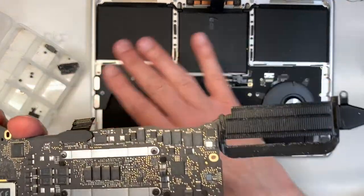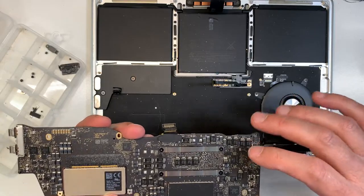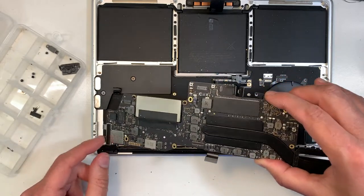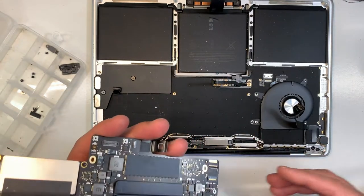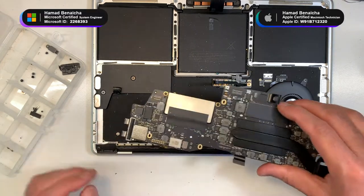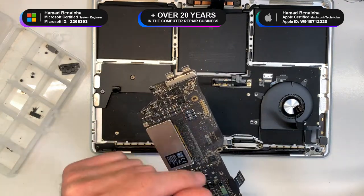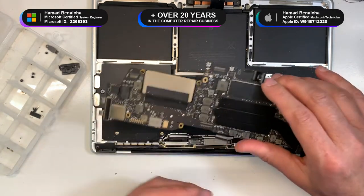Flat. Make sure there's no water or liquid whatsoever on the table or whatever you're gonna put it on. Be careful, don't scratch any components, okay? Because sometimes when people put them back, they end up scratching components over here, and then they end up with a new problem. Again, I just go based on the things that I've seen. Again, 23 years experience, you've seen a lot of things. So they force it, and then when they bring it over here, there is no backlight or something like that. Right away, I know where to look, so I can tell this is a backlight circuit. So just be gentle, don't force anything.